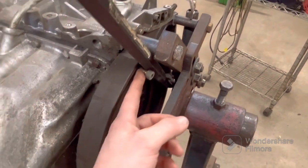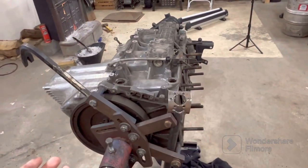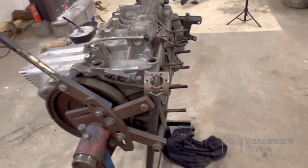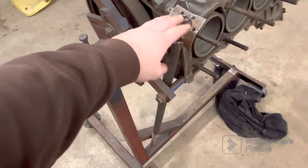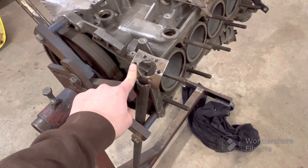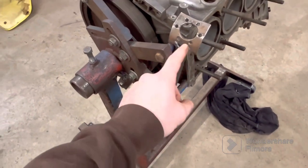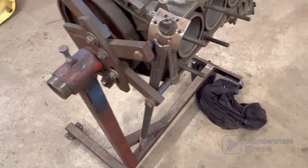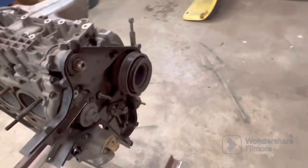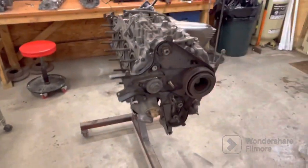So what I ended up doing is I put one of the clutch bolts in with a pry bar against the stand and wedged that in there. And then, as you probably saw in the video, I kept having problems with the whole thing rotating. So I took this piece of pipe that I actually machined. This is bolts on the end of an N51 BMW engine from when I did one of those, and I jammed that in there against the stand, and was able to hold this thing to loosen the crank bolt with the breaker bar. So that was a little bit of a fiasco.